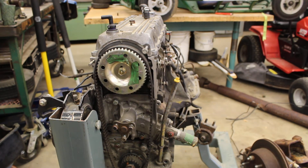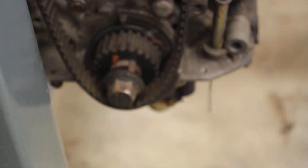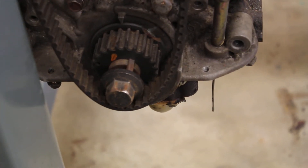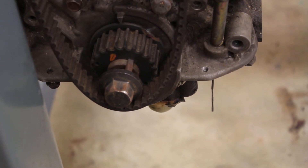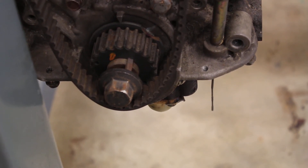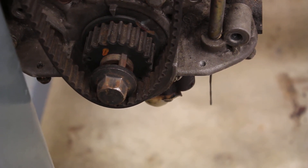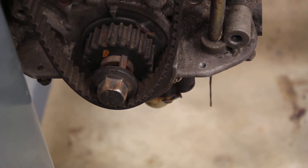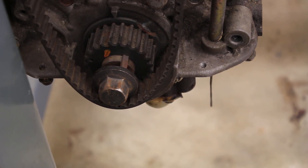You can sometimes get the marks lined up perfectly, and then as you route the belt around the gears something turns, something moves, and you've lost timing. When you replace a belt it's always important to hand-crank your motor. There is your crank pulley bolt — it'll have the harmonic balancer on the front. Take your spark plugs out so you're not fighting compression, and turn the motor over carefully by hand with a breaker bar. Listen and feel for interference. Don't use the biggest breaker bar you have, because with too much leverage you might not feel pistons hitting valves. If you detect interference, stop rotating, dismantle things, and double-check.